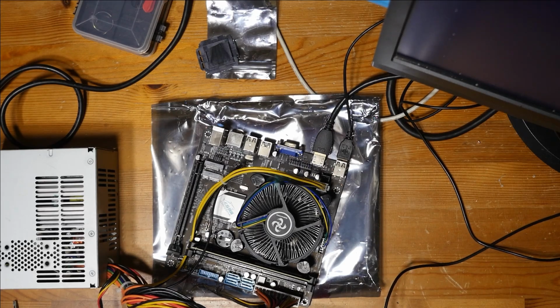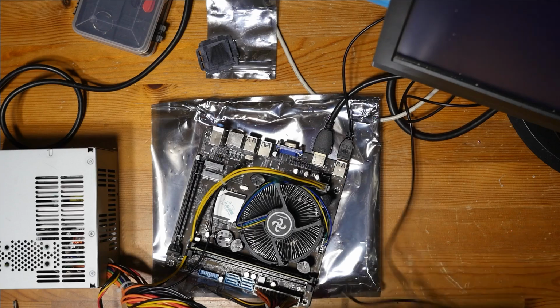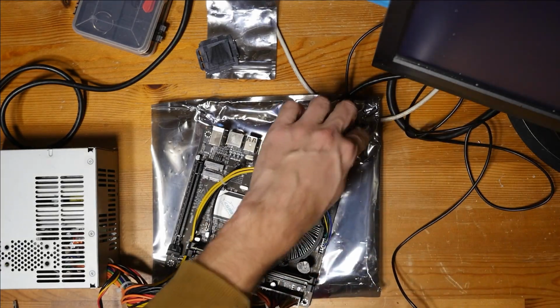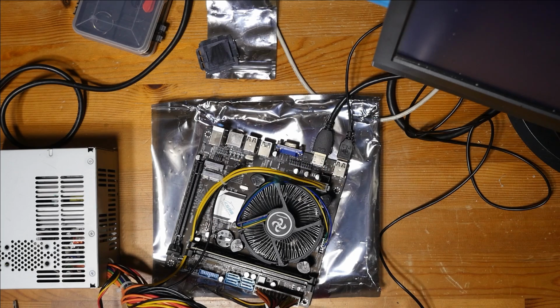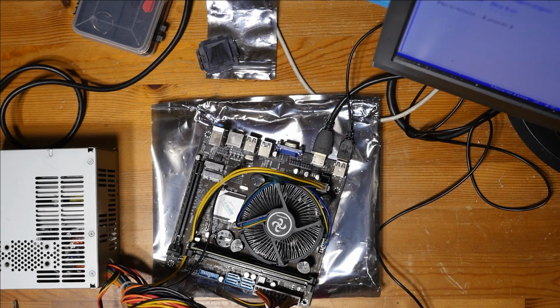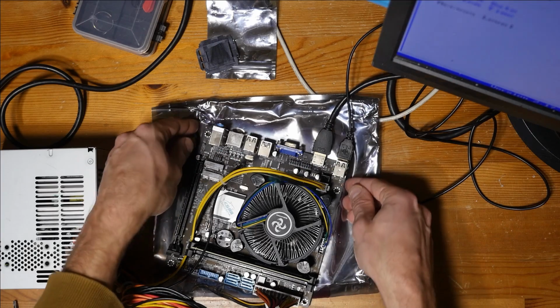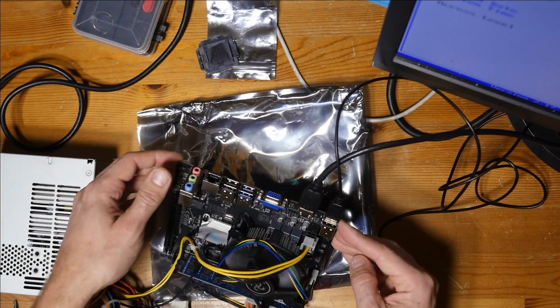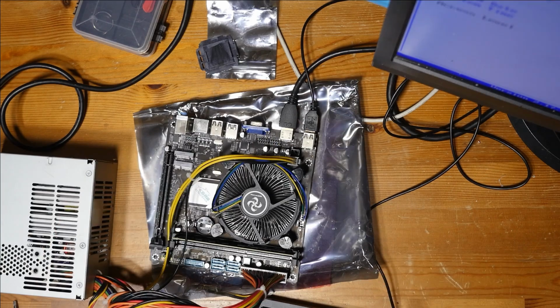I'm kind of hoping that there's one specific port for BIOS, and my hope is sort of getting confirmed because I'm getting a status light here now. Oh, yeah, on the bottom right port. Okay, let's see if the capture device works. Oh, there we go. Yes! Okay, so the trick for BIOS to work is to connect the keyboard in here. Okay, I can work with that.